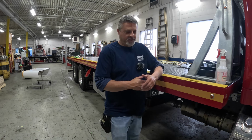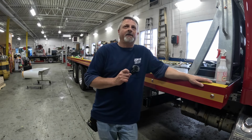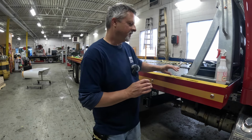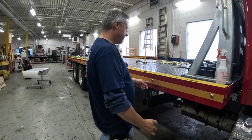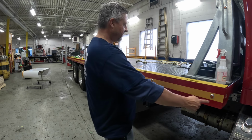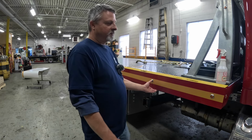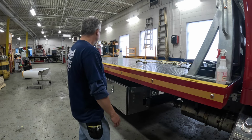Okay, now that I got this side restriped, it does look better that I use my guideline, but let's reflect back on the errors of my ways. Was it my computer cut circles that were off? No. What was causing the dipping? Well, I decided to measure up on each light to center, and these lights, so my error actually was assumption, assuming that these lights were 2 feet on center and the same 3¼ inches up or 3⅛ to the center. That was the error of my ways. So these lights are not all perfectly in line, which I don't know why I was assuming they would be, but that's what was throwing me.